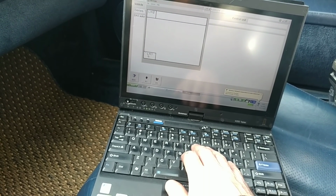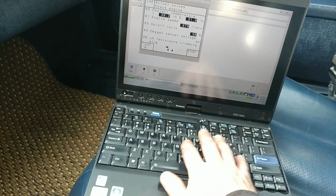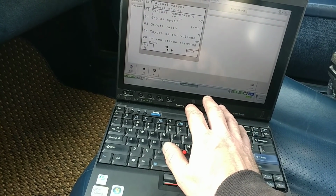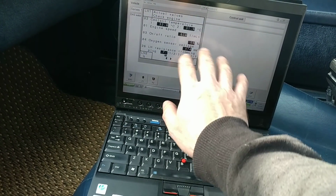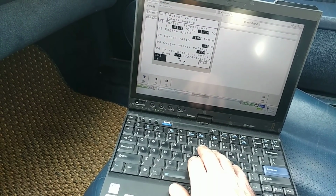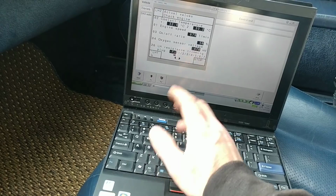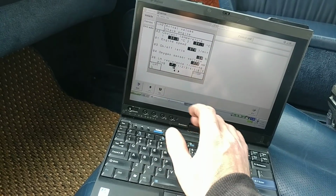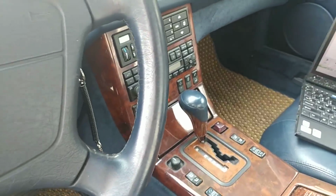Now I wanted to see live readings, just so you know. The live readings coming from the computers, as we can see, are pretty much even here. Now it's at 50%, because it's a cold start, and as you can see, the oxygen sensors are not reading right now because it has to warm up. The coolant temperature is 33 Celsius, which is nothing pretty much. So we have to wait. I might pause this video and make you another addition when temperature is up to operational temperature.